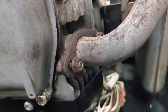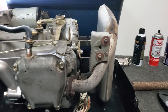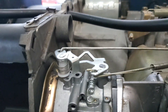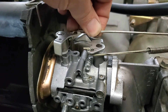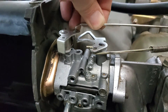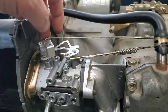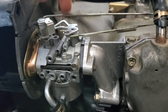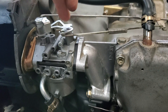The muffler on this side is held on by two bolts — you can take that entire apparatus off because moving it with the muffler attached is a bit of a hassle. But if you do that, you need to disconnect the line that controls the choke. This line is just a wire bent at the end; it has to come out at this end. You also need to remove the throttle line when removing the carb — same deal, except there are two wires that both need to come out and be reconnected the way they were.